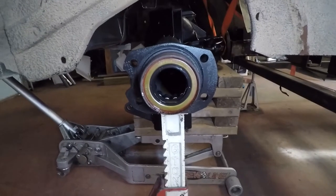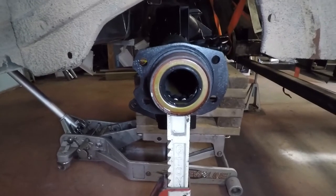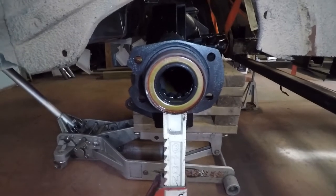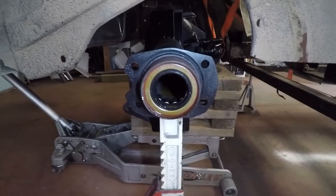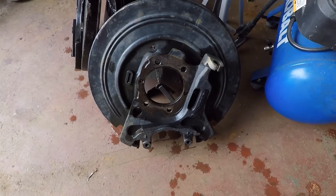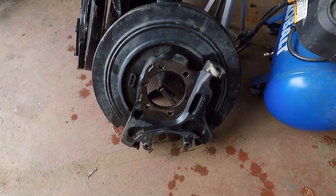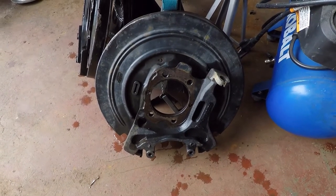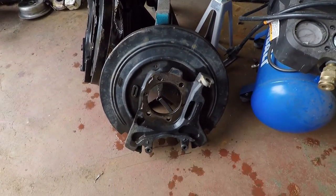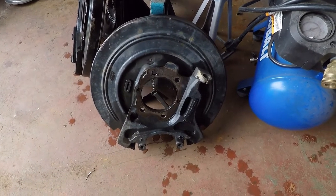It's been a little time this morning. I'm going to put the rear axle bearings and the new seals in, and just dump a little rear-end oil on the bearings and spin them around — make sure they're pre-lubed — and did the same thing with the seal. So that's all finished. Then went and grabbed the backing plates for the rear end, pulled the brake shoes, and we got some parking brake shoes because they were bad, so we got those straightened out and washed up. We'll scuff those up, put a little bit of paint on them on the outside, and get those ready to go back together.